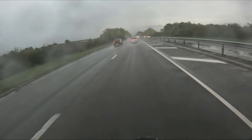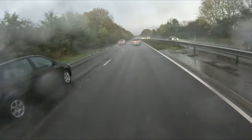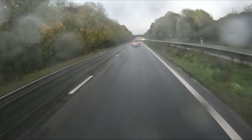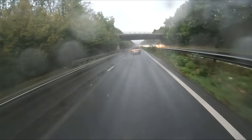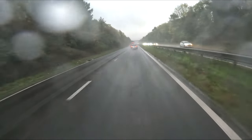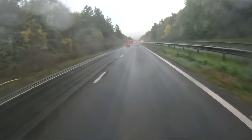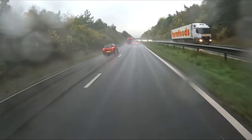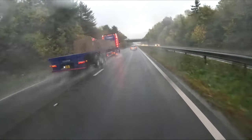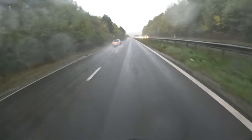The other problem is the corrosive properties of salt and water being flicked all over your bike. I used to live near the sea and spent a lot of time on speedboats, so I know a bit about how a boat engine sucks up sea water to cool itself. For it to be able to do that, the engine has to be marinized — protected against the salt water. Also, the engines have sacrificial anodes stuck onto them, and the chemical reaction with the salt causes them to degrade quickly so that the engine doesn't get destroyed. This has always made me wonder why we don't have them on the bottom of cars and on bikes. It does tell us that salt will destroy your beautiful machine. A quick story: my mate at work has got an MT07 — a lovely bike — but he rode it all through winter and didn't wash it once, and this thing is now going rusty from top to bottom. Once these things start to rust there is no stopping them.